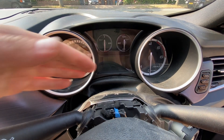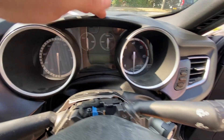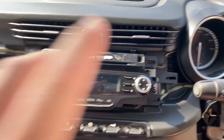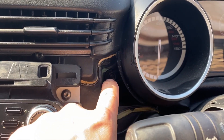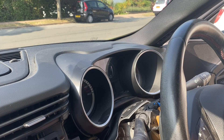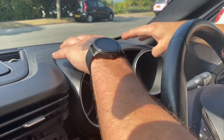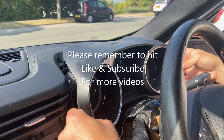To get some extra visibility and maneuverability for where this piece fixes in underneath, I'm going to release and remove these panel pieces out a little bit — popping off this fixing for the panel piece here, and taking off this whole panel piece too, since I know there's a fixing behind it. With that panel piece and switch set removed, we can see one fixing there and one over the other side, both T25s. With those out, it should just be a couple of clips at the top and bottom — locating wedge pins — and the whole thing should pull forward.